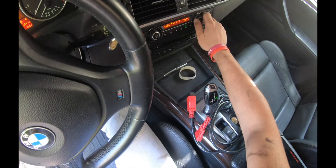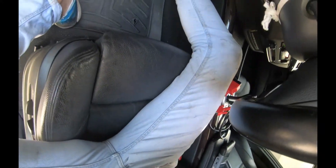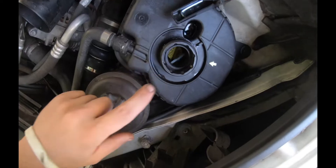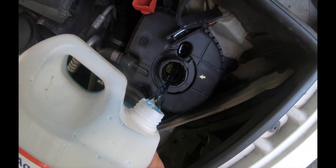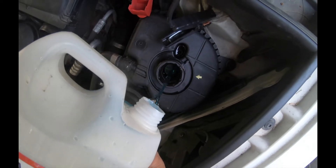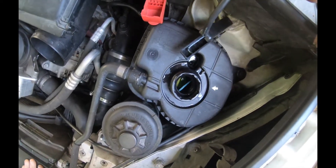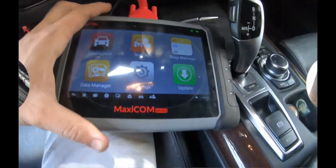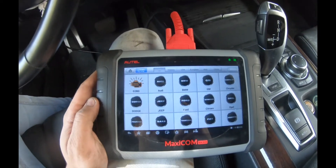For the bleeding process, connect the negative cable of the battery. Set the ventilator to the minimum, the temperature to the maximum, and press and hold the gas pedal for 12 seconds. The fan is now on. We fill the coolant to the maximum level and you can add more during these 12 minutes if you see that the level drops below the minimum. The pump is working now — bleeding process is underway, coolant added to the maximum level.